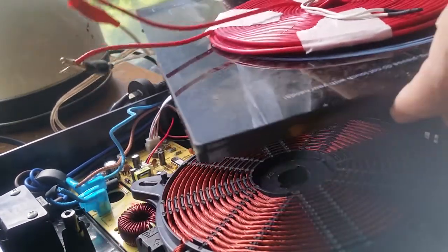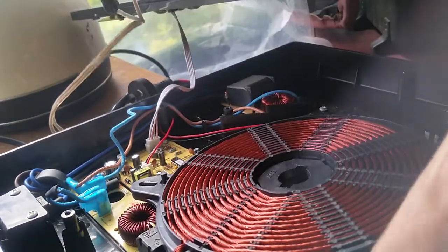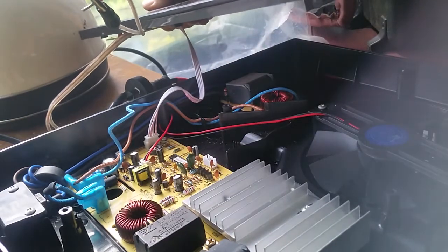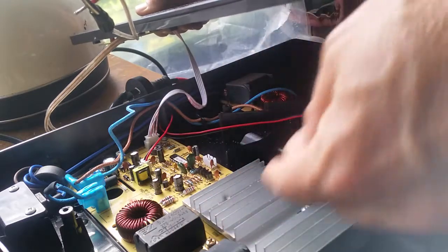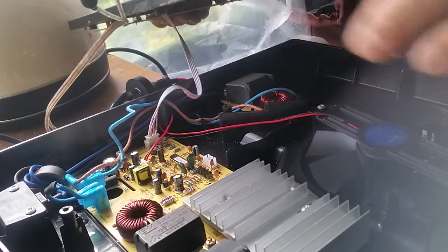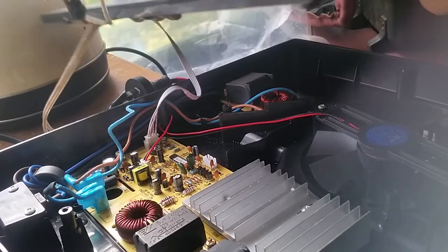Other mods that would certainly be worth doing: pull out this board and get some pieces of copper that you've pulled out of some wire, and run that along the current path tracks and lay some extra solder down so that you've got really good current-carrying capacity.